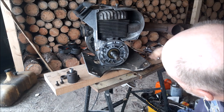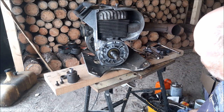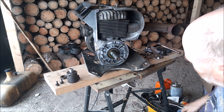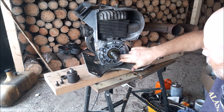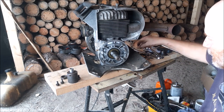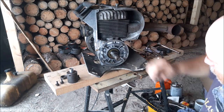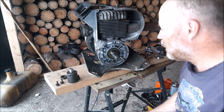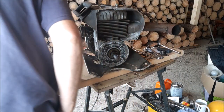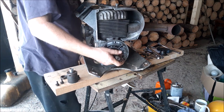And that seal looks like it's kind of been leaking just a little wee bit, but I'm not 100% sure of that. But if it looks like it's leaking, I'm going to be putting a little bit of goo on there. I really should replace it, but I didn't see a whole lot coming out of there, so I'm not going to be too worried about it. I will be checking the crank side as well to see how bad it's leaking. So I'm going to put this washer back on, and do not lose your little flywheel key or else you're going to be searching for another one or buying one. I always check to see how badly they're worn, and that one's not worn at all. So I'm going to set this out of the way. Take a quick look in behind the clutch, and the clutch looks clean in there, so I'm not worried with that. So I'm going to set this down out of the way.